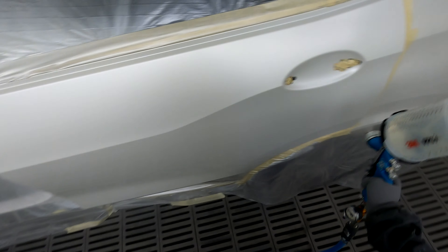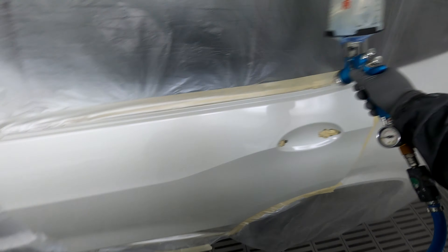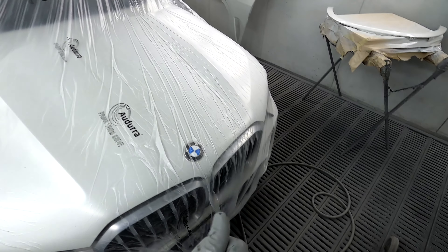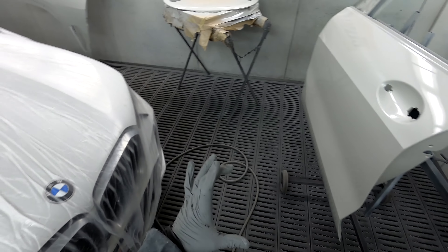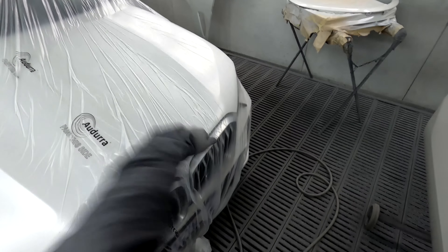That's a pretty good colour match — it's blended out nicely across this door. I actually had a colour card for this. We don't do many BMWs at this workshop, but we do quite a few Mercedes. I did one of these about eight months ago, same colour. Every time I do a three-layer I'll spray it out, keep the colour card, and spray it with two-pack clear. Then next time that colour comes in I can check it straight away without having to rematch or do a new spray-out. That's what I did here — saved me from having to do a spray-out.